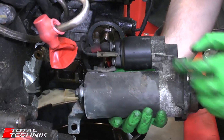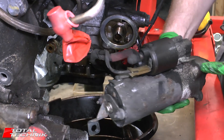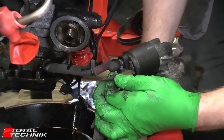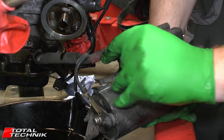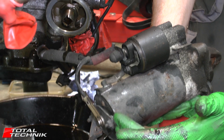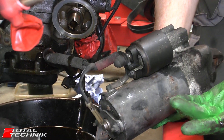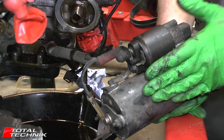There's your starter motor with a couple of electrical connectors on the back, so those need to be disconnected and then we can get rid of this starter motor completely. There are a couple of electrical connectors in here — the first one's just like a little spade connector, and the second one has a little nut in there. As per the Audi Workshop manual, if you're doing this job 100% properly, this should be disconnected. Technically you could leave these two on and just put this to one side, but now you've got this far, you might as well pop it out and put it completely out of the way where it's safe so it doesn't get crushed.